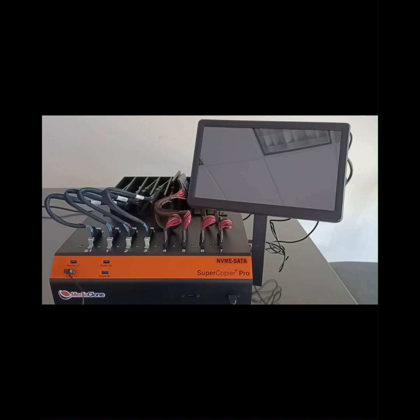One important remark about the open tray concept we are using here is that it has a few benefits compared to the server enclosures that many of our competitors use. With an open drive tray, all the drives are open to the air. The ventilation and the cooling of the drive are much better if needed. The user can even add an external fan, especially for NVMe SSDs that get very hot. Also, the user is not restricted to only drives with 2.5 and 3.5-inch sizes. For USB ports, there are many USB 3.2 ports in the front of the unit and in the back of the unit.